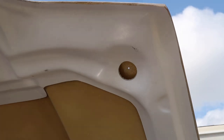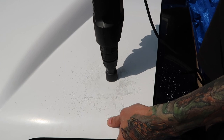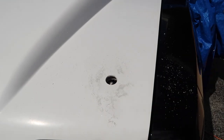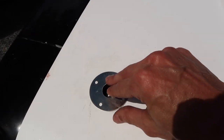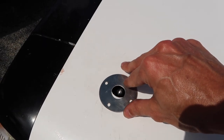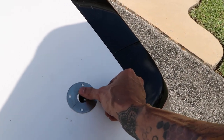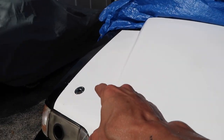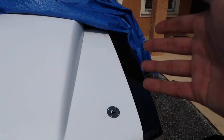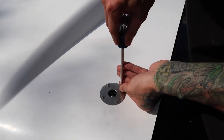There she is! The holes came out very, very clean and I'm very happy with them. Now we just have to get these little plates oriented the way that we want them — they'll slide off since there's nothing holding them and the hood is angled. Once we get the plates exactly where we want them, we can marker off the four little holes on each plate and then screw in the little screws that hold the plate to the hood.